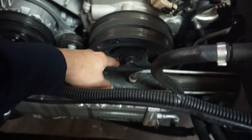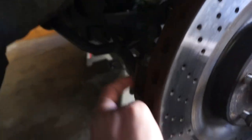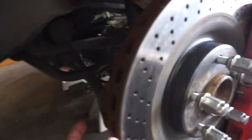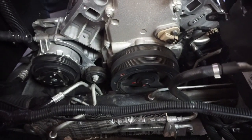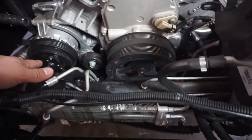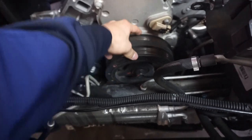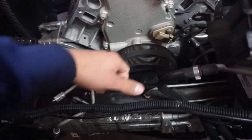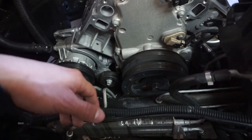We're going to have to go ahead and disconnect all these lines — we're gonna make a mess, so that's going to be annoying. Then you're going to have to take it off from the knuckle, bump that nut off, and hit this thing hard so it can pop off. Then you can move it to the side or completely take it out. I'm probably going to take it completely out just to give me more space. Once that comes off, we can pull this bolt off, then we'll need a special tool to get the crank pulley off, and once that's off we can get to the timing cover and then the cam behind it.